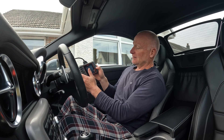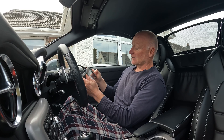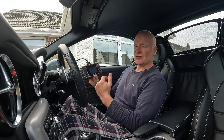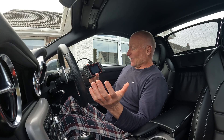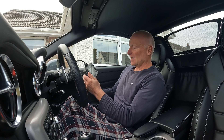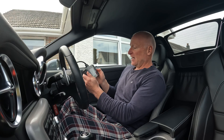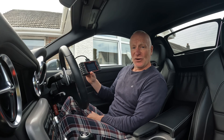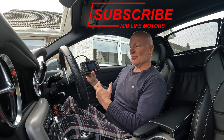What it's going to do is try and identify the car using the VIN number. You can put your car in manually, but with this latest software it should — fingers crossed — be able to do this automatically. It reads the VIN code, and here it pops up. I know on this car the last three numbers are 339, so that is correct. It's telling us it's an AMG SLK 55 and it's chassis number 172, which is what this car is. Ignition is on — the scanning has started.